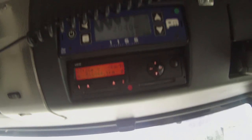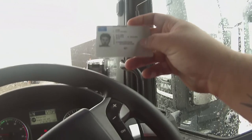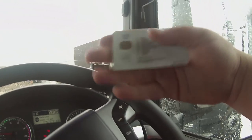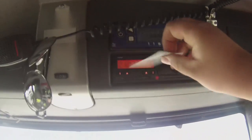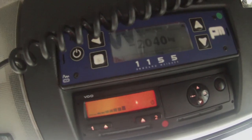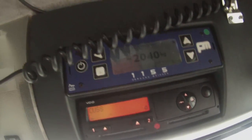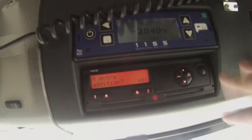You've got a couple of arrow buttons and a backwards button. So what you do is, first thing in the morning — I've just turned up at work, my tachograph card isn't in yet — so I get my tachograph card, which is this. It's the same as the driving licence in a way, but with a chip on the back, and that chip is where all the data is stored. So you just slot it in, chip facing up into slot one, give it a push in, and then you see it will read it. The time is 7:27, but UTC time is 6:27 — because we're in BST, British summertime, the clocks have gone forward an hour, but these run on UTC time.